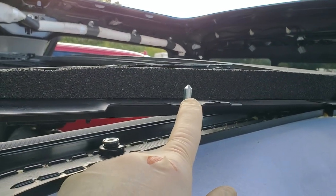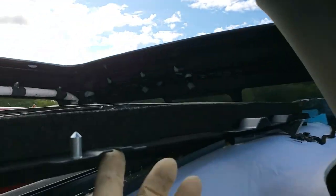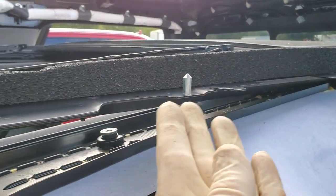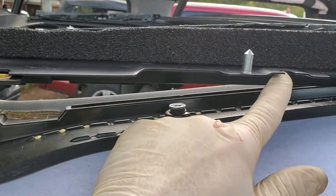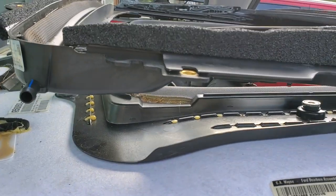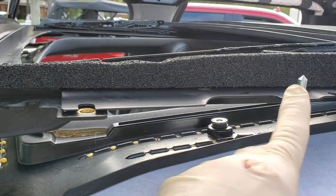Here's this pin I told you about earlier — it's going to go in this hole right here. I'm going to lift this up and use my impact with a 10 millimeter to put that right there and trap it, then do another one down here. It will stay long enough. It's better if you have somebody on the other side making sure it doesn't slip out, because these are U-shaped holes, not round holes. You could put one in the round hole if you wanted to. Start with these guide pins — that centers the whole thing.